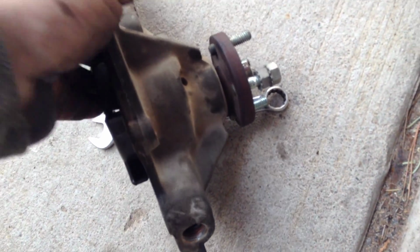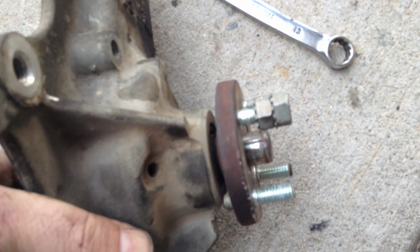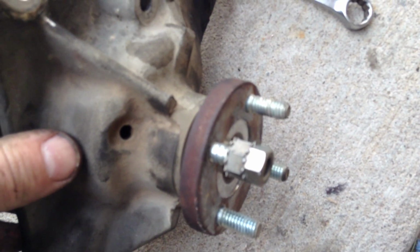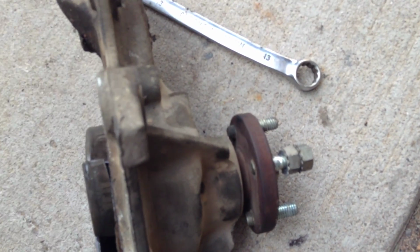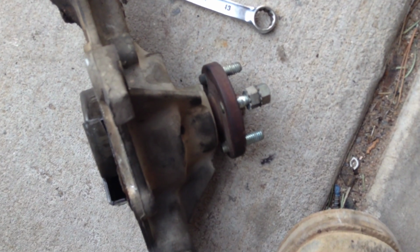As if my day didn't suck enough, breaking bolts off and forgetting my phone, so I'm over here without anybody to even phone a friend. I realized after I start putting the other water pump back in that this right here, these studs, so I took the bolts, jammed them together, and used a wrench over here, held it in place, and just unscrew them. And I'm going to install them in there. The other one after I've already put it in there, so yeah.